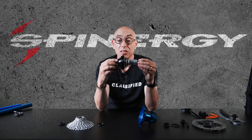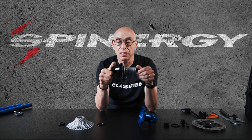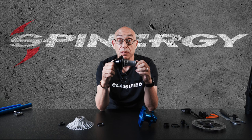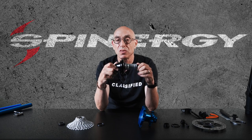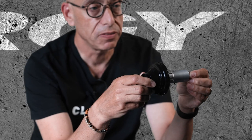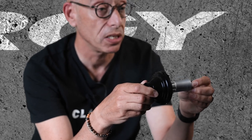When the system is in standard mode it's a one-to-one relationship of the rotation of the wheel to the cassette, and then when you hit your switch it reduces it so you actually only turn the wheel 0.7 rotations for a full rotation of the cassette. That's effectively the same as moving from the large chainring on your bike to the small chainring.